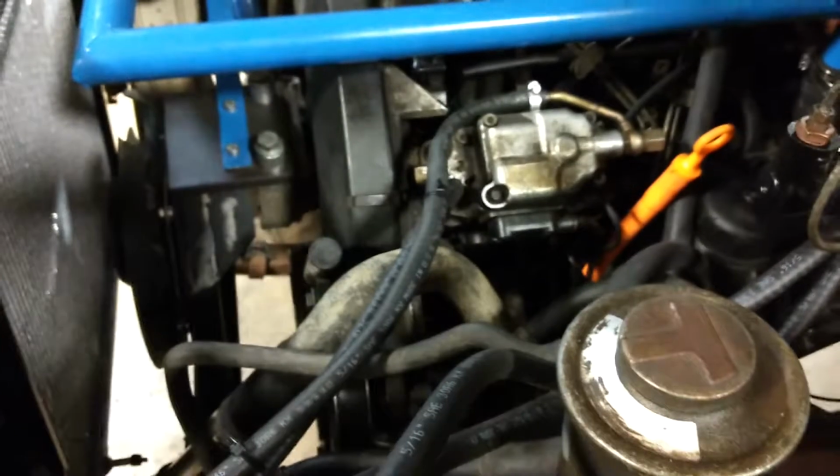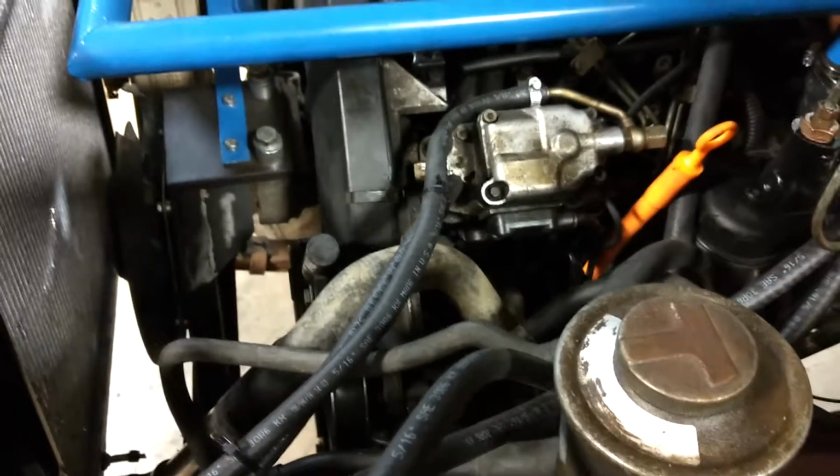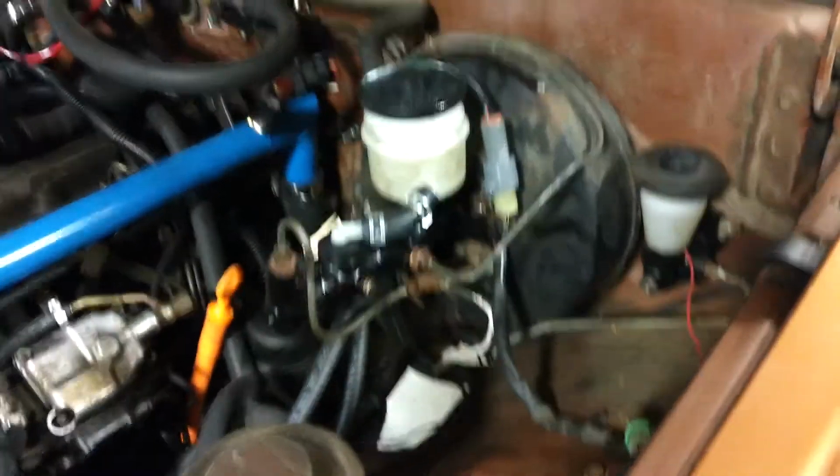I need to get the right power steering fluid. The Volkswagen won't compress regular ATF, so I got to go grab some of that special Volkswagen fluid. My assumption is that the gearbox on the Toyota will take whatever fluid it's going to push through without issue. So put a new master cylinder on. I've still got to rebuild the calipers and go through the process there.